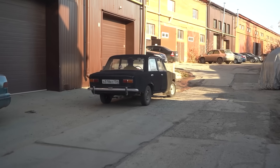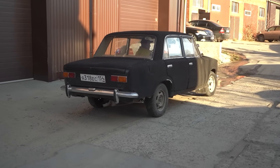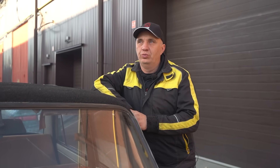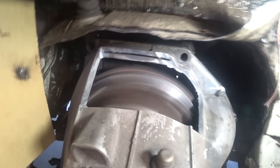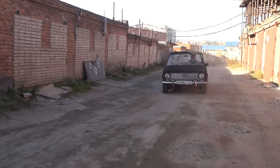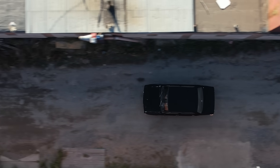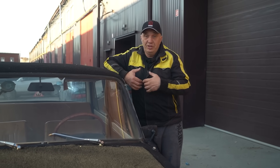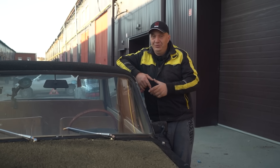It also revs up slowly. So that really heavy lead flywheel actually works very well. There is no slip, it's not getting bent out of shape, the gears change all right — it's just like any other flywheel. But there's the smooth acceleration effect: the car does not abruptly pick up and go when you press the gas. And the revs are slow to drop. But if you need to get going, you put it in first and the engine is more than happy to pull at super low revs. You can lug it around, the car sets off, engine operation is nice and smooth, and it just starts to move instead of stalling. That's a pretty nice benefit.